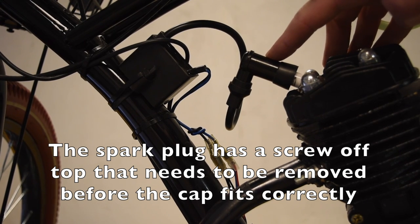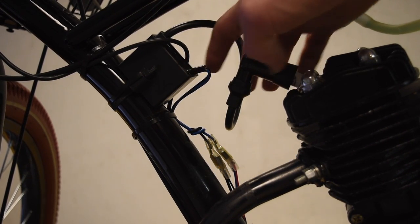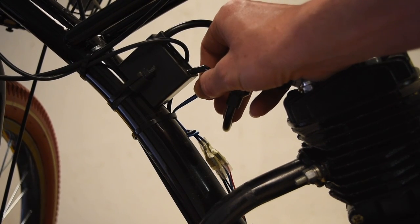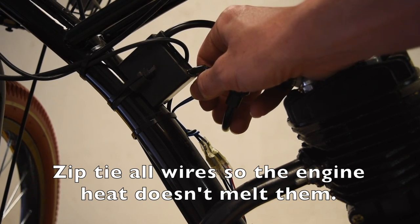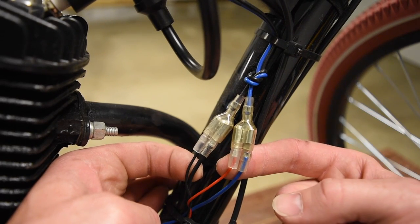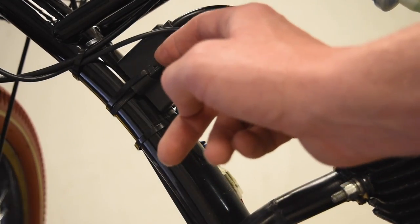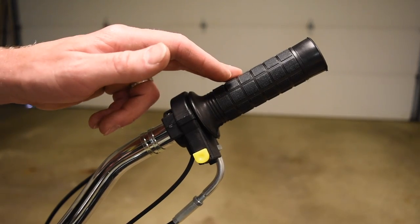The top of the engine is the spark plug and the little cap that goes on top of the spark plug. This runs to the CDI. Out of the CDI are two wires that go to a splitter. Two of the wires go to the kill switch on the handlebars and the other two wires go to the engine itself. Blacks go to blacks and the blue and red go together. There are bolts that come with it so you can strap it on, but I just used a couple zip ties and it works pretty securely.